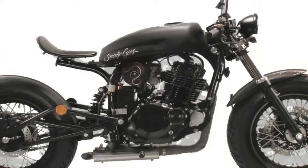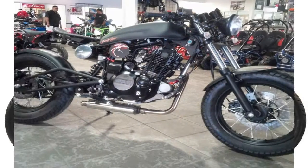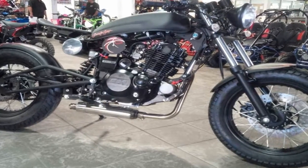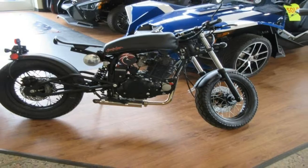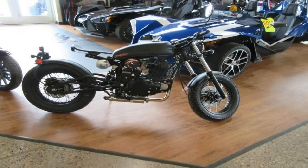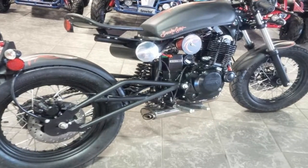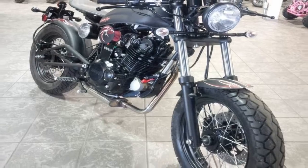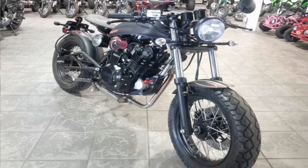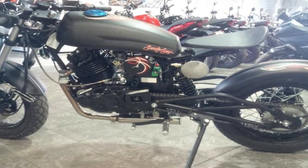Simplicity is a recurring theme with this bike, and the engine is no exception. The one lung thumper is as basic as it gets, with cooling fins to radiate waste heat to the atmosphere and a good, old-fashioned 26mm CV carburetor to control the induction. A time-tested capacitor discharge ignition manages the spark with nothing from the electronic wizardry shelf to complicate the works, but who would want traction control and rider modes on a bike like this anyway, right?